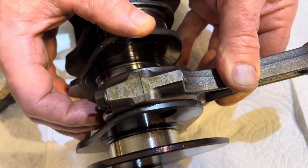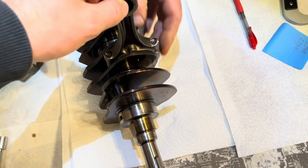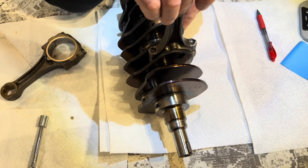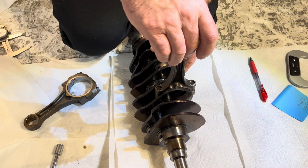And you can hear the movement — those eight to ten thousandths are audible. You can hear it, whereas when it was on cylinder one, three, and four, you couldn't hear any play. So that's a floozy.